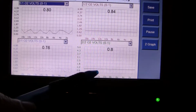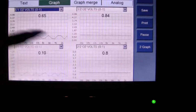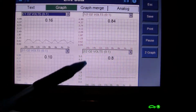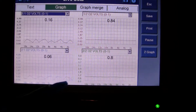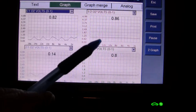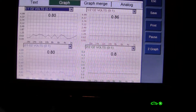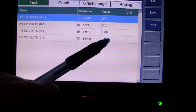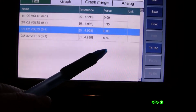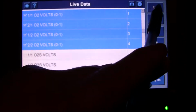The reason I say that is because they're supposed to stay steady. If they start fluctuating, then it obviously means your catalytic converters aren't working anymore, because it's letting too much exhaust gas through. It's not picking it up anymore and removing the gases. But at the same time, you would think I would have some kind of response. That's 3/4 throttle. Sometimes if your O2 sensors either aren't working correctly or aren't reporting correctly, it could also be that there could potentially be plugged cats that will do that too.